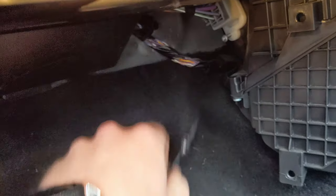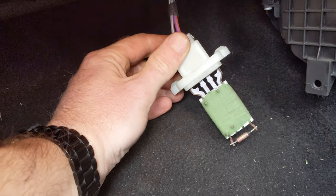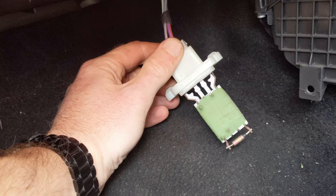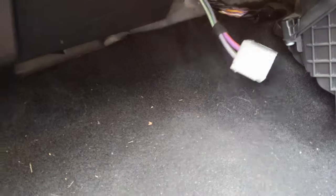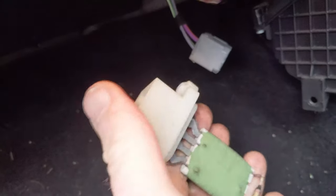T15 up at the top - two screws, both dead easy to get out. The top one is a little bit more tricky, but I think you will get in there. Once you've undone the second screw, pull and the loom will come out. Obviously have the car switched off when you're doing this - you don't want to get electrocuted or burned. Just literally press the button to release the loom. Just four connectors in that, and that is what is faulty.